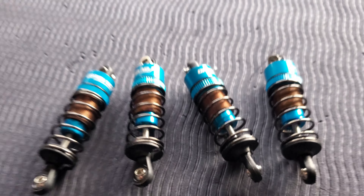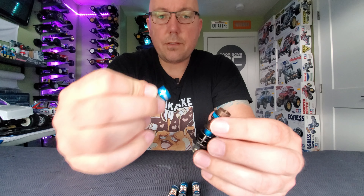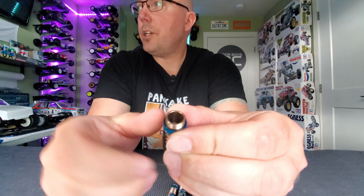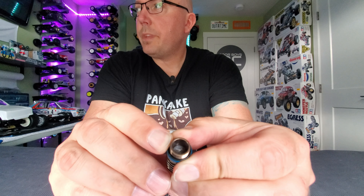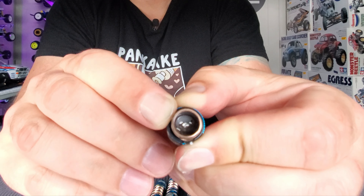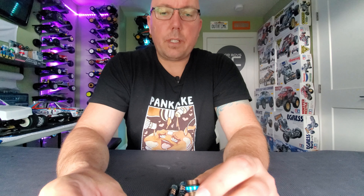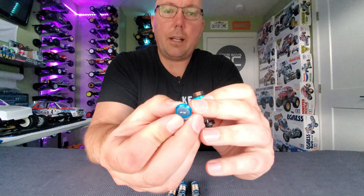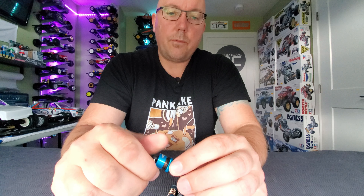Now let's go a step further — start taking the shocks apart and see what they look like on the inside. So there is a little bit of oil in there; you can see some nice shiny residue, so we know the O-rings inside aren't going to be damaged. The shock isn't full of oil — I think they just put enough in there for assembly purposes. We're leaking a little. It looks like a two-hole piston in there. Assembly looks like it was done well, and it does have the bladder in here to help keep from leaking oil.